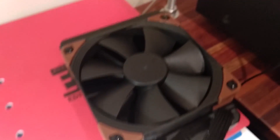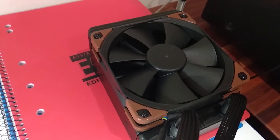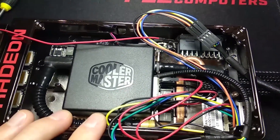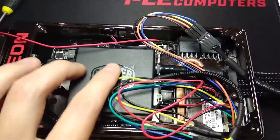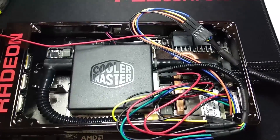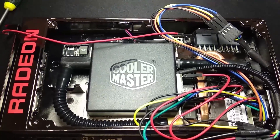The fan I've decided to use is this nice Noctua fan. I've always been a big fan of Noctua fans — excellent static pressure, really quiet, and it seems to actually keep the card cooler than the original fan did with far less noise. So it's definitely worth looking into upgrading it if your original fan is playing up.